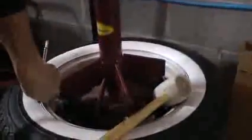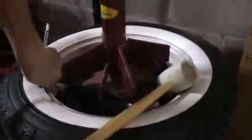There shouldn't be any air pockets at all. If you feel any air pockets or you feel any wobbliness in the portal wall, then you'll know you might get a ripple or a crinkle later on. You want to make sure it's nice and flat. Just keep hammering it down until you see it totally flush on the wall of the tire, and then just inflate your air.